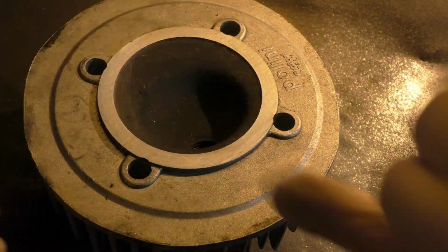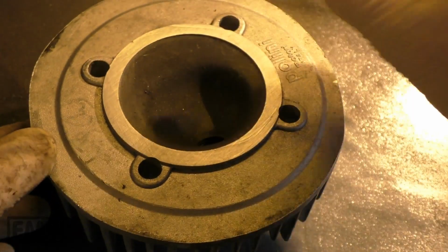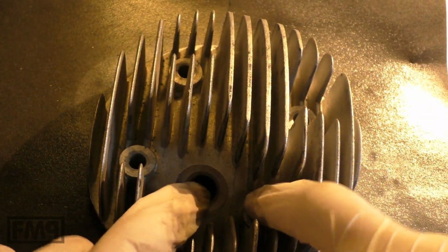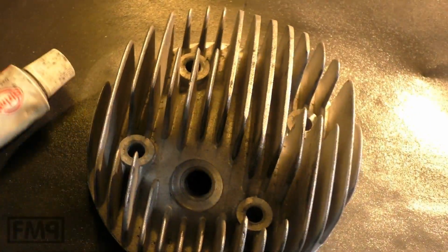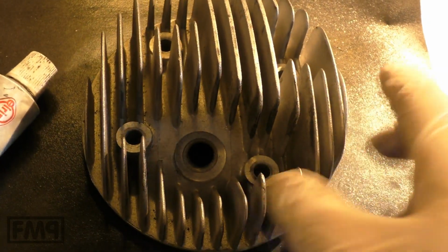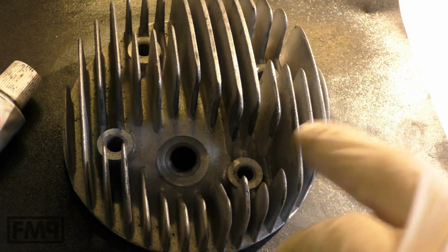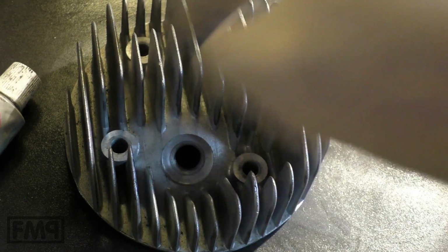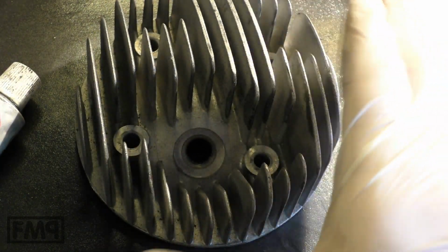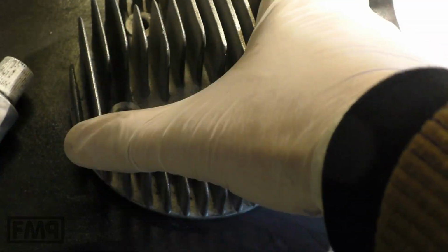And how do you mount a cylinder head? You put additionally some sealing mass on it, just a little bit. You then clean it from the inside, if it's squeezed outside. Then you mount the head and you use a torque key. 1, 2, 3, 4. And what was it with M7? It was 12, 13. Use a torque key so that they are even, tight, with the same torque, and that the cylinder doesn't get bent. Because, you know, the cylinder head of course pushes down the cylinder.